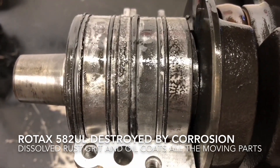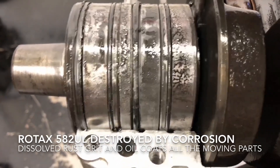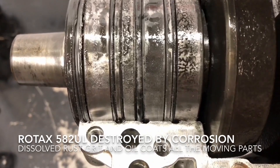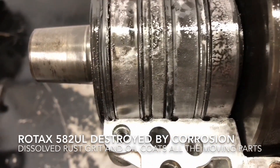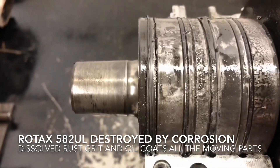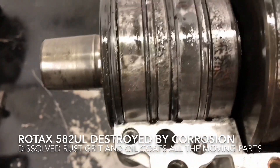Now the space in here — you shouldn't have that much room in there — and then obviously you can see the loose bits that are inside, probably the cage out of the bearing. The whole of these bearings are all moved towards the back, and this seal is actually from the outside of the engine. I can see the seal was about halfway out.